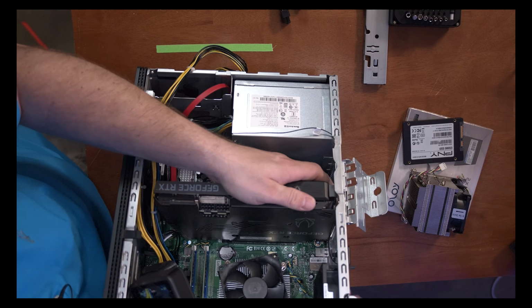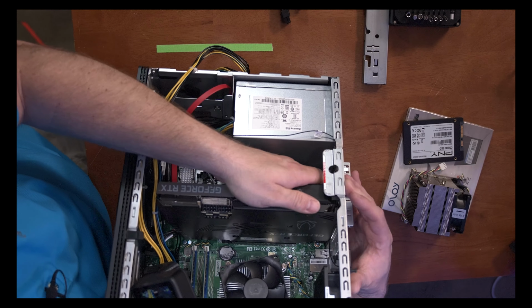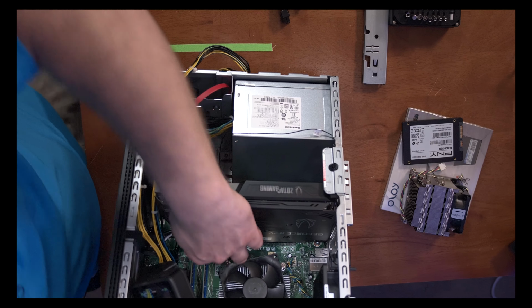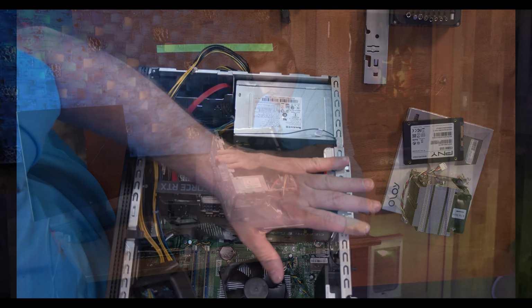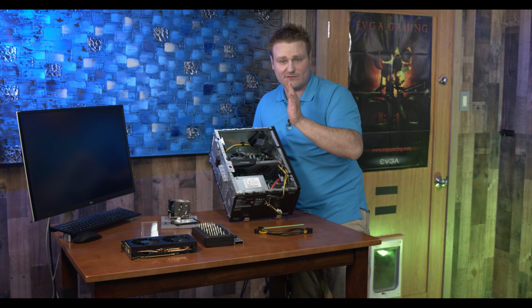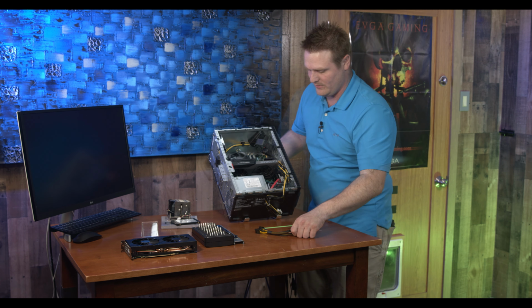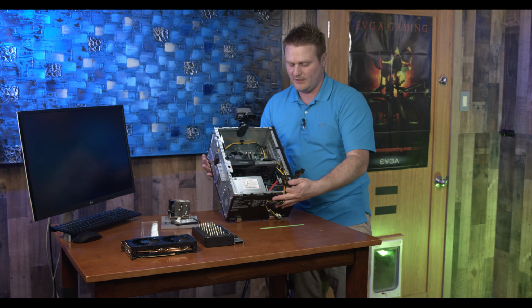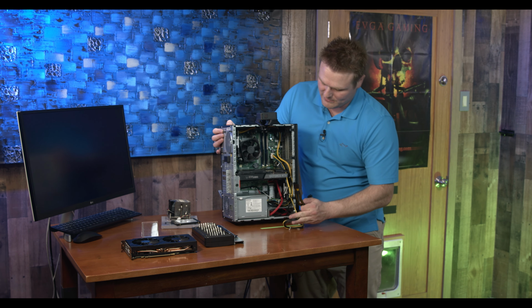and it didn't snap in. You can snap this door if it's lined up off to the side right here. I could see it, but it didn't snap down here in the bottom. You kind of want to, there you go. It was nice and loud and crisp. So I had to kind of put some pressure down at the bottom. With the whole constant even pressure, sometimes you do have to put more pressure on one side of the graphics card. So I'm going to attach the power wire to the graphics card before we attach it to the power supply.